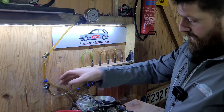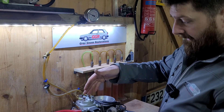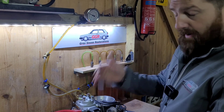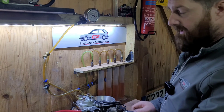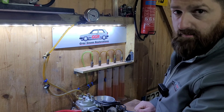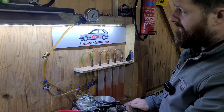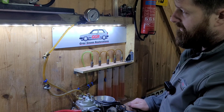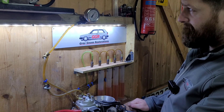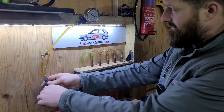So let's do the system pressure test now so you can see the difference. With the tap open we get our system pressure — notice how quickly that pressure comes in, unlike K-Jet where it has to act against a spring and shim and build up slowly. This goes bang straight to fuel pressure. There we are: 6.2 bar with the tap open. Now we close the tap, cycle the ignition again — 5.8 bar differential pressure. That's 0.4 bar difference, exactly where we want it.